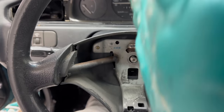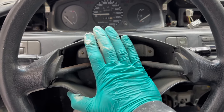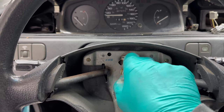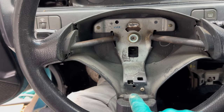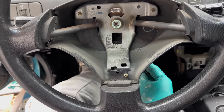We've got all three Phillips screws in. To put the steering wheel back on, slide it over the spline and make sure it's aligned with your wheels — it might be slightly off, so you may need to adjust. Assuming the steering wheel was straight when you took it off, it should be good. Put the 19-millimeter nut back on and tighten it — use the manufacturer's torque specs because you don't want any problems. Then put your airbag or horn assembly back on, plug it in, and put your Phillips screws back. That's it for replacing the ignition tumbler switch in your EG 92-to-95 Honda Civic. Drop a subscribe for more tips — thanks for watching.